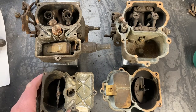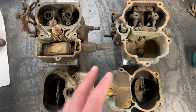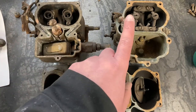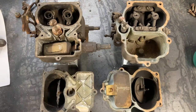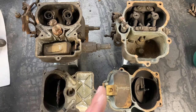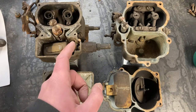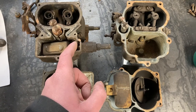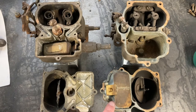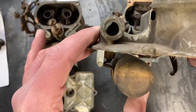We've got both tops removed from the carburetors — Stromberg 97 on the left, Holley 94 on the right — and you'll see a lot of similarities. Here are your main Venturis. Your accelerator pump is in the center of the Stromberg where it's on the left-hand side on this Holley. With both carburetors open up like this, you'll notice a large difference between the floats. The Stromberg needle and seat operates horizontally with the float inside the bore of the bowl, whereas the Holley float mechanism is involved with the top cap and the needle and seat operates vertically up and down.